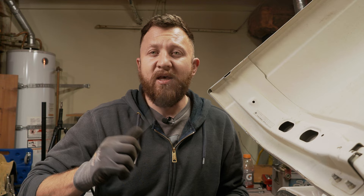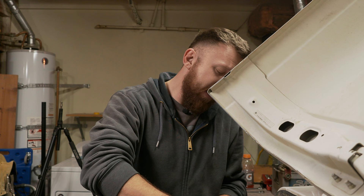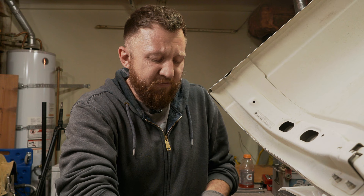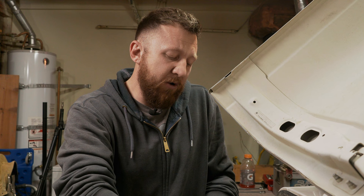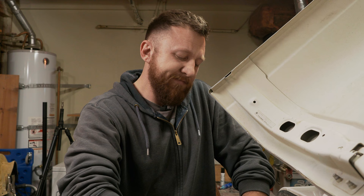There is a way around this. If you're really diligent about it — about once a week, you put a battery tender on it and let it charge overnight — you'll probably get away with prolonging the battery life. But what I've been finding is that when we're on trips, the AGM just does not perform as well, simply due to the fact that my Jeep is not fully charging it. When I had the solar on it, not a problem — the solar charged it all the way up all the time. But without the solar, maintaining that AGM battery, the Jeep's just not capable of it.